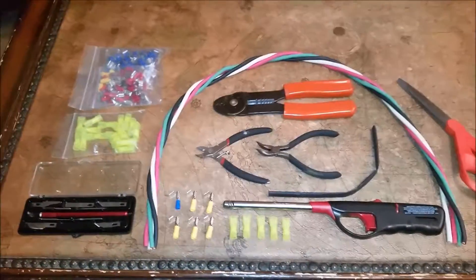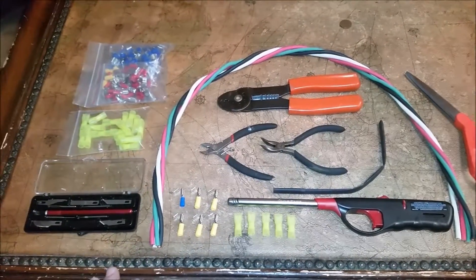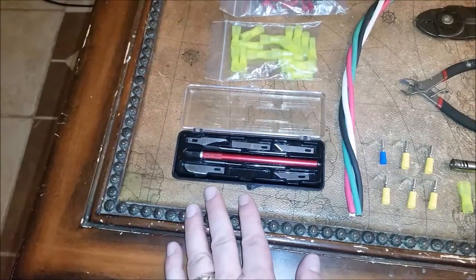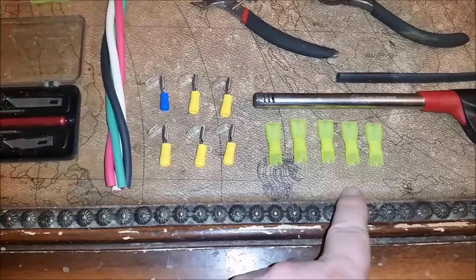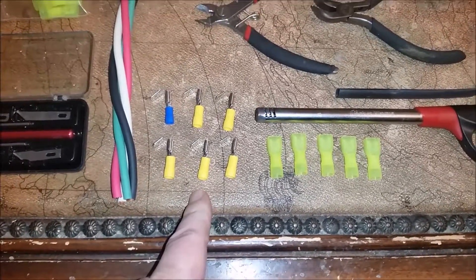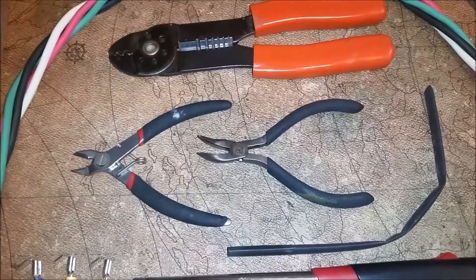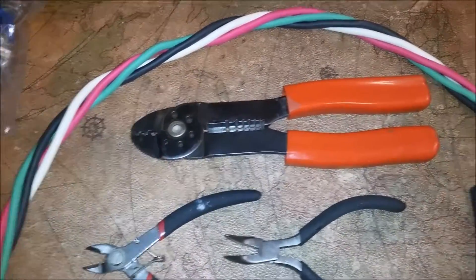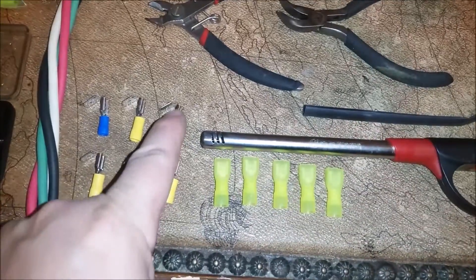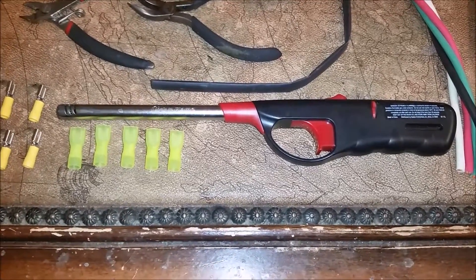The things we're going to use to accomplish this: some tools and the cable — I cut about a foot and a half to two feet to make sure I had enough. You'll need an exacto knife set to cut the wires, some crimps I bought off eBay — specifically the piggyback terminals — wire cutters, side needle nose pliers to get crimps and wire terminals off, a crimper with the 10-12 size teeth, half-inch heat shrink to keep things insulated, scissors, and a candle lighter or heat gun.